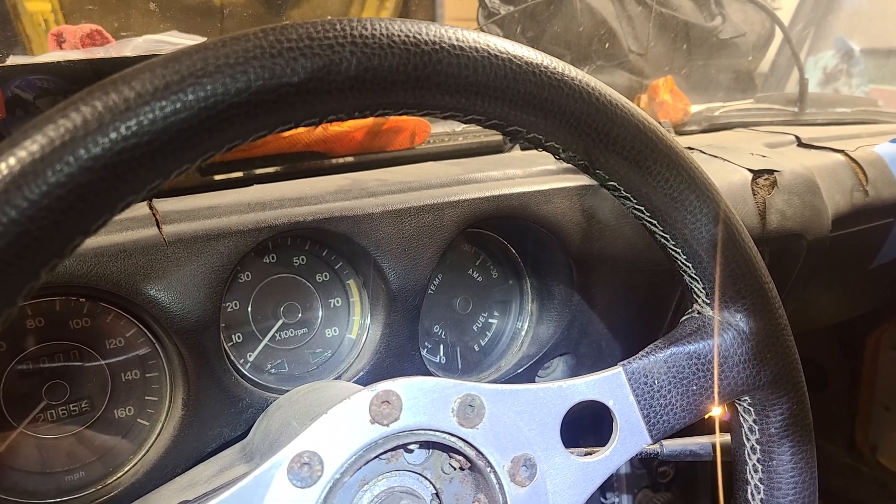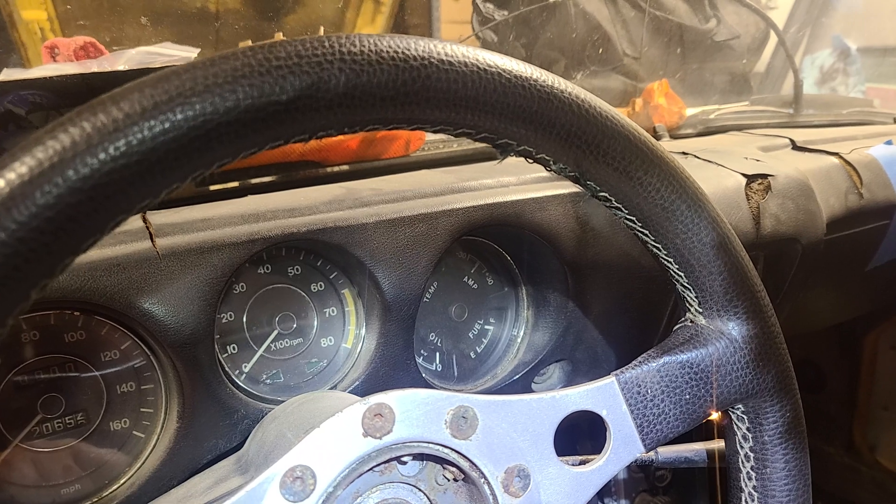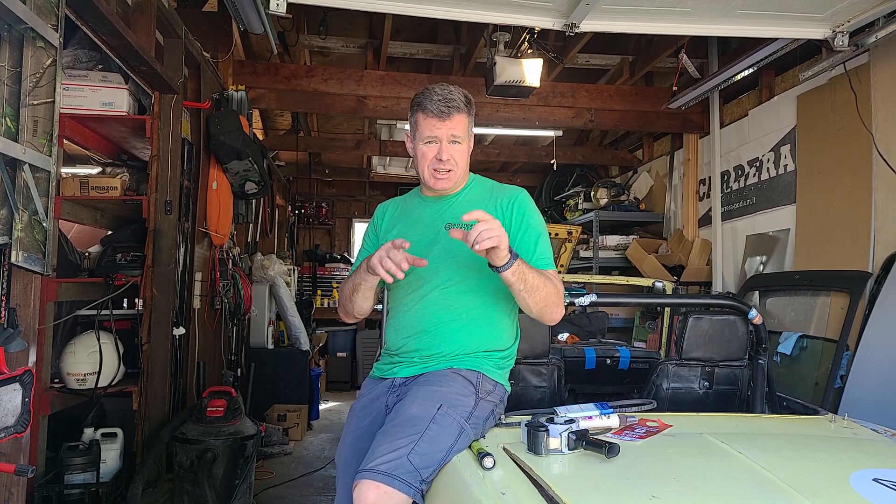There we go. She's a little stubborn in getting there, but she gets there. So it turned out it was actually pretty accurate set up to about 9 volts. A lot of guys online have said between 8 or 9 volts is the setting that works best for these. I would suggest just get your fuel tank to a known quantity — preferably full — and then set your buck boost module with the potentiometer to the right voltage that gets you to the right point on the gauge. And it's really that simple.